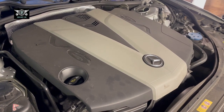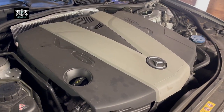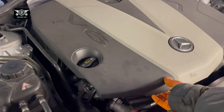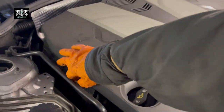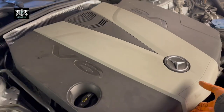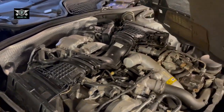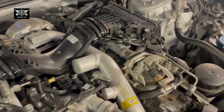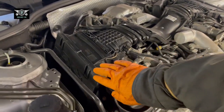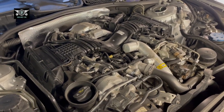There are two air filters on this model as it's a V6. We're going to start by removing this cover here — it just pops up, it's just plugged in. Just unplug it and take the cover out. The air filters are going to be located one here and the other one on the other side.